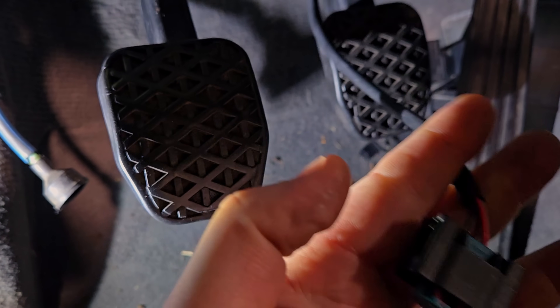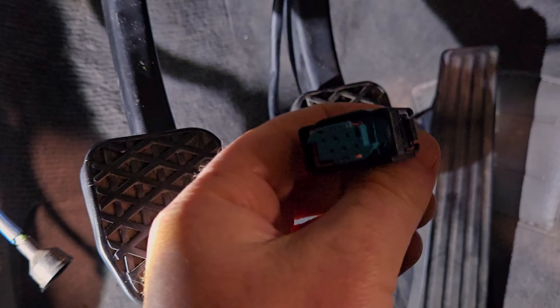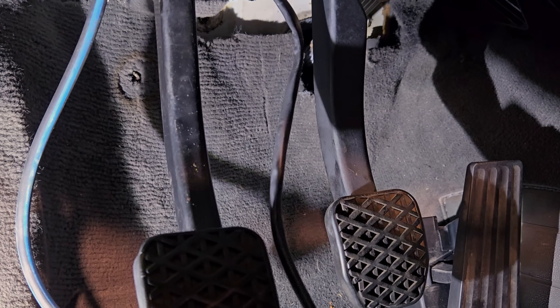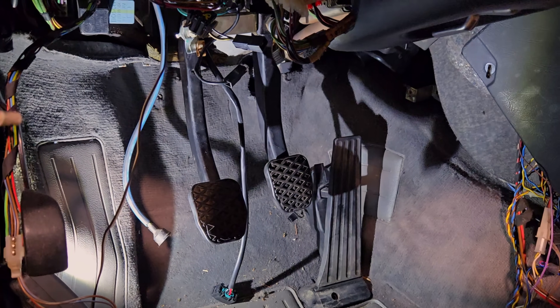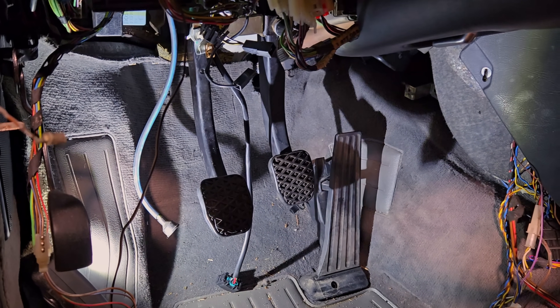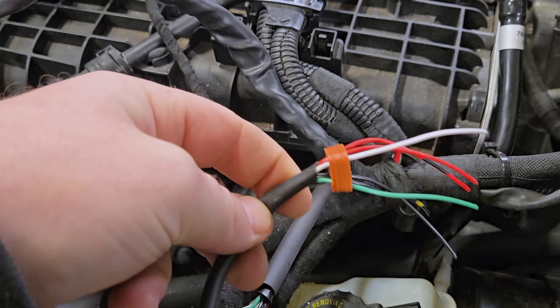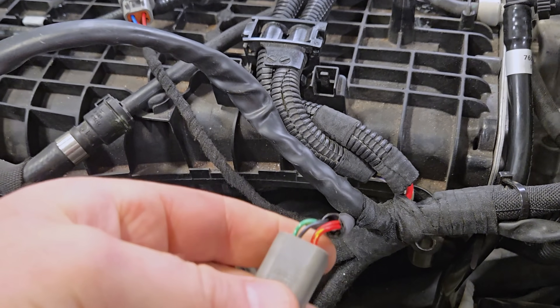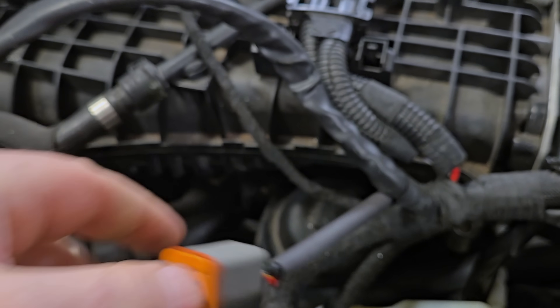SCS made that connector for us. The only thing is that this connector comes straight from their wiring harness and we could not disconnect it from there — otherwise we would have to drill a hole, which we're not doing on this vehicle. We're trying to preserve OEM as much as possible. So we cut this wire that's coming from the pedal — it was integrated into this main harness here — and we're making our own connectors so for future disassembly we can just disconnect it right here and remove the engine.